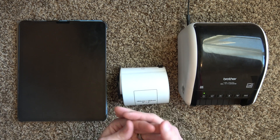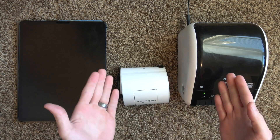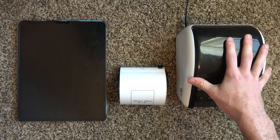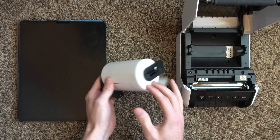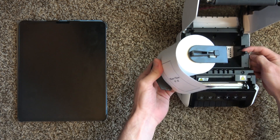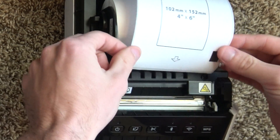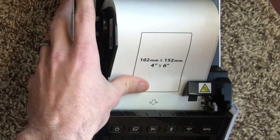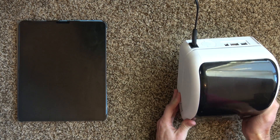The Dymo 4XL — the technology is from 2004. That printer is actually terrible, but we'll get into that in another video. I have this printer set up just as I would have gotten it from the factory, brand spanking new. We're going to pop it open and load the labels. You can see this foot right here — this arm foot goes right here and the arm rests into a little notch right here. We're going to load the labels just like that and close the top.